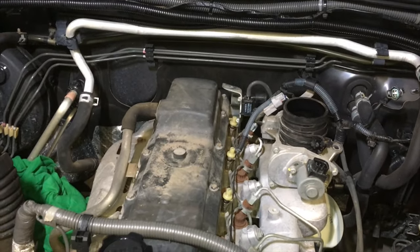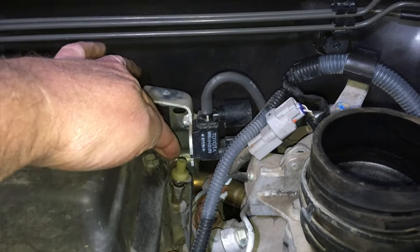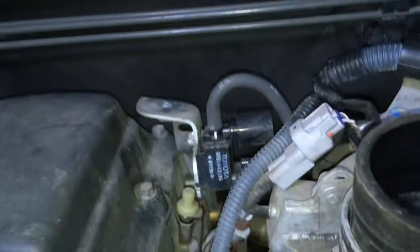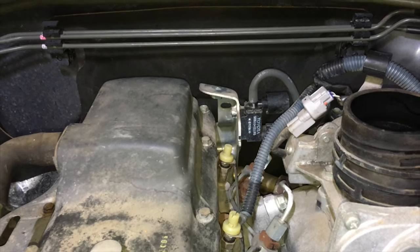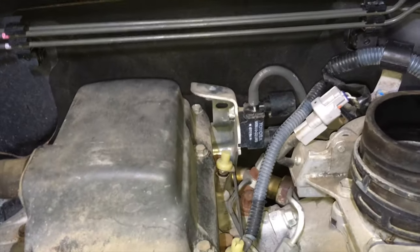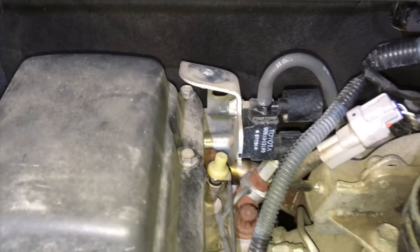What I suggest — it might sound dodgy but this is what I do: get in here with a shifter, hook it over this bracket, and bend it back just slightly — enough to get to number four glow plug. Take note of the angle it's on before you bend it. You're only going to do this once every 200,000 kms. All you need is an extra five or ten mil clearance — I'd call it 'tweaking' or 'reworking,' not bending. Just bring it back to the right angle when you put it back together.